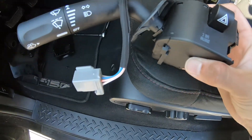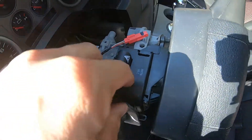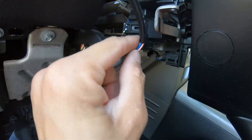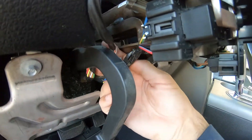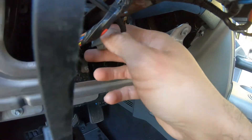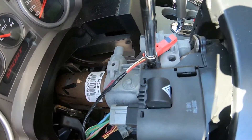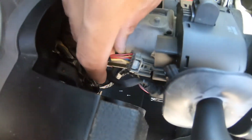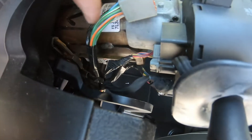Here's the aftermarket one we're going to put back in. Once it's lined up, just slide it down into place. I'm going to rewrap — take the turn signal wire, route it back through, up beneath the wire harness, and plug it back in. Then back down to the 5.5mm bolt on the turn signal switch, plug up the bottom connector, and plug up the top connector.